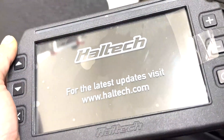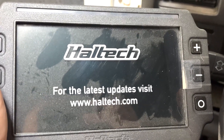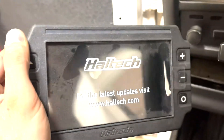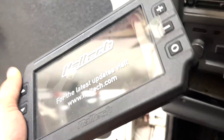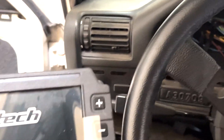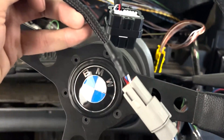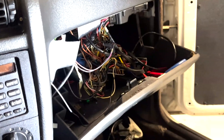I got a couple more wires to solder behind the dash. Okay, this is the IC7 — a little dusty. I set it up in what I think is called the ICC software, which you can download from Haltech's website. I have the bezel as well, so it'll fit like factory mounting and look nice and clean. I'm going to run the CAN bus wire — I already got it all set up over there — so it plugs right into the ECU. I'm going to run that across behind there and plug it into the wideband controller.